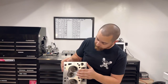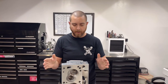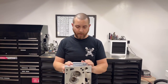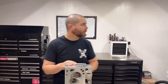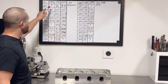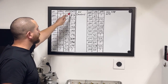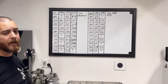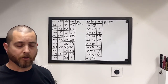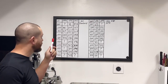It's a much more modern, much more efficient chamber design. These 2v heads are set up for a 2.1 intake and a 1.65 exhaust valve, and they actually flow pretty well. I took the time to write down the numbers. What I have here is Pro Max, VP for our flow numbers, and CHI — because these really look like the CHI 2v cylinder heads.